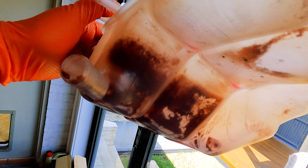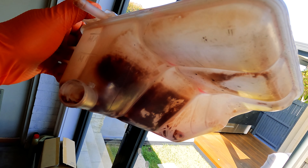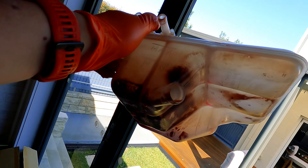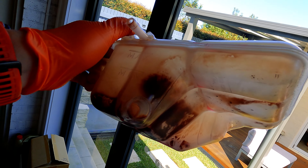Now that your coolant bottle is off, take a good look at it before you throw it out. If you've got these sorts of deposits like I do, it's not really much to be concerned about. Your engine block is made out of iron and iron rusts. This isn't a lot of rust — about 10 years worth of deposits. Little bits of the block will start breaking away and end up in your cooling system, which is why it's important to change your coolant regularly.